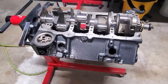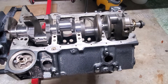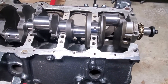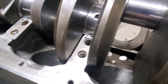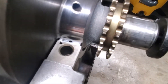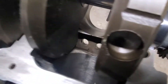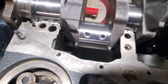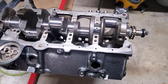Okay YouTube, here's part two of the build on the 355 small block for the Le Mans. We finally got the crankshaft polished and it's dropped in — cleaned and dropped into the block. Bearings are brand new, we dropped those in and this thing came out super nice. You can see here — let me take this cap off — you can see all the bearings. It's kind of hard to mess up because you've got these little notches, so they only go in one way. We put all brand new bearings in one by one and got this thing polished up — it came out awesome.